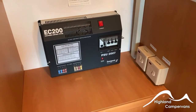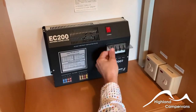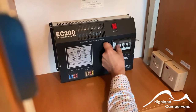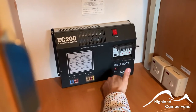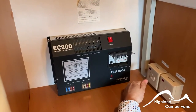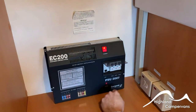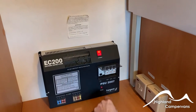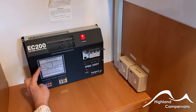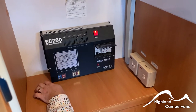Your main control panel is located at the back of the wardrobe. We've connected the van to the power supply externally — connected to the side of the van. With the cover flipped up you can push up on the end switch, carry out a circuit breaker test to establish that you've got mains into the van, and then come across and turn on all of the mains functions. This will operate things like the electric elements for the water heater and the room heating system. Your three-pin sockets will also work. Separately on top of the unit you've got a battery charger — all the time you're plugged into mains it will trickle charge the battery. You'll hear a circulation fan cut in because it does get quite warm. On the left-hand side there's a bank of 12-volt fuses, listed in the instructions, covering things like interior lights, water pumps, fans and so on.